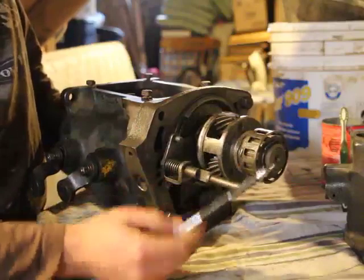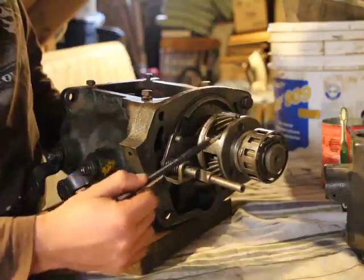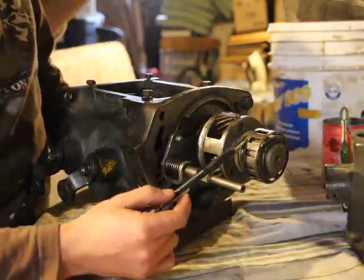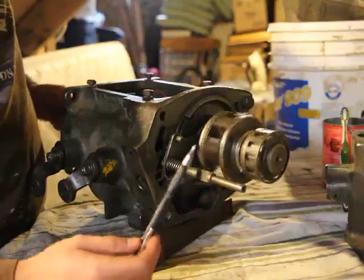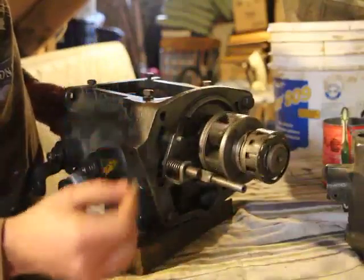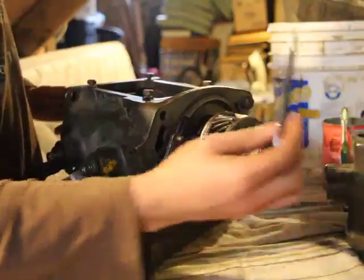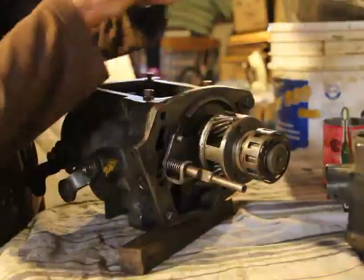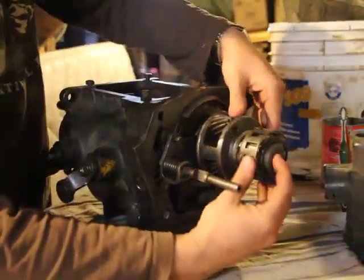Now as you can see, this one is smaller than this one. So the outer speed of this one is going to be greater than this one. But they're actually connected together, so they both turn together. I'm not talking about the outer speed, the circumferential speed. I'm talking about the rotations. If this one completes one rotation, the other one completes one rotation. If they complete 3 rotations, they both complete 3 rotations. They end up at the same place. I can't move them independently.